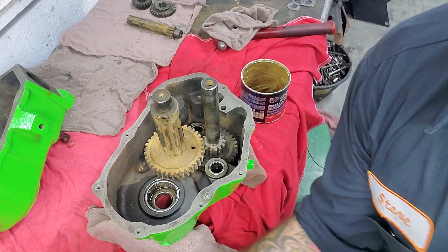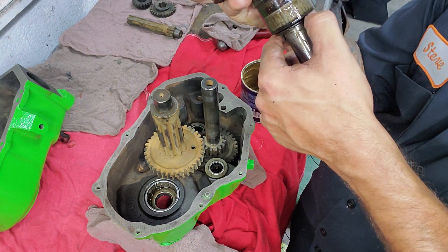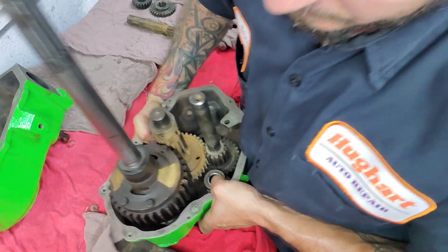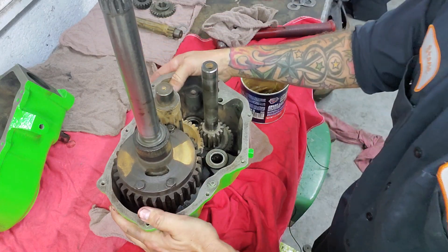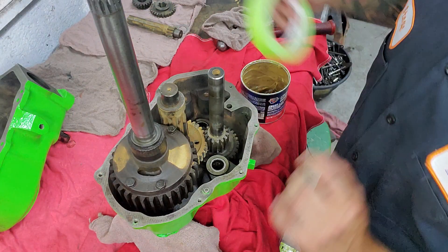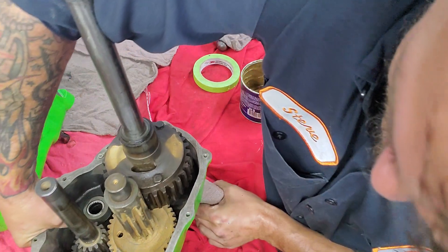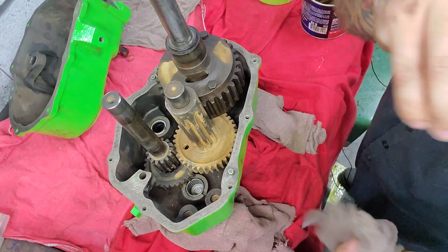From there we're going to put our differential in. It's got three shims per side — bolts have to face up. I just left it the way it was from when I took it apart. That's got to go in the hole in the table and it's just going to slide right into place. Now that's going to be the more tricky part. When I pre-assembled it, I noticed this thing's pretty easy to put together.